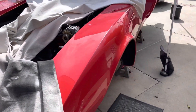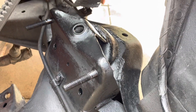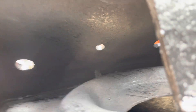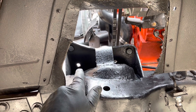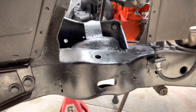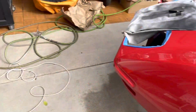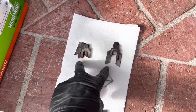It is some time later. I took off the upper A-arms and there was all kinds of mess down in there — that made a nice little pocket for dirt. I found a tire balancing weight in there, which is not good. I cleaned it up and painted it with the VHT, same paint. The bump stop isn't necessary because the new arms have a bumper built in. I've got all my shims ready to go back in.